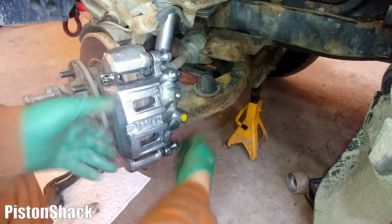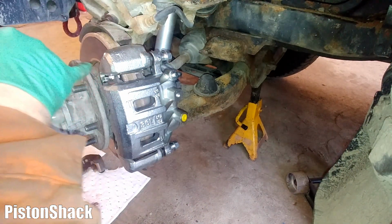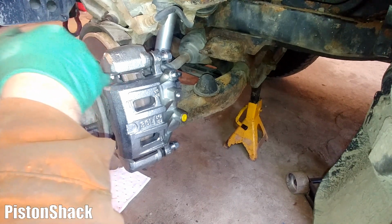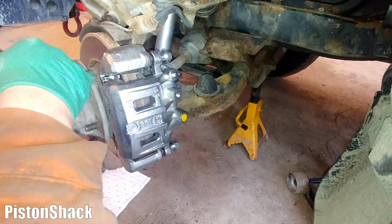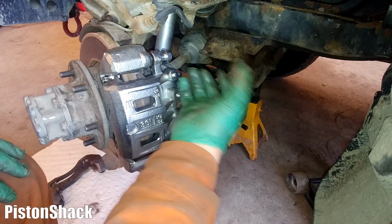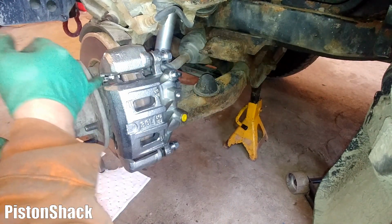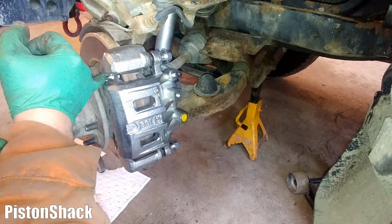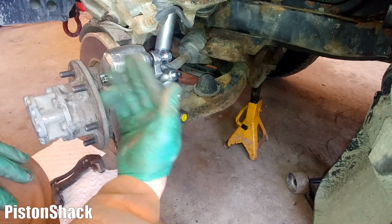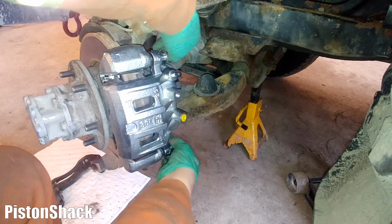See how nicely it's sliding? That's how it should. When you put grease over here, that's what's causing the pad sticking to the rotor, because the pad should move slightly back and forth. Compression hydraulic force is 5 times higher than releasing force. And when you have lots of grease here, and dirt, then the pad might sit on an angle, not be able to go back, and then you will end up with uneven wear.